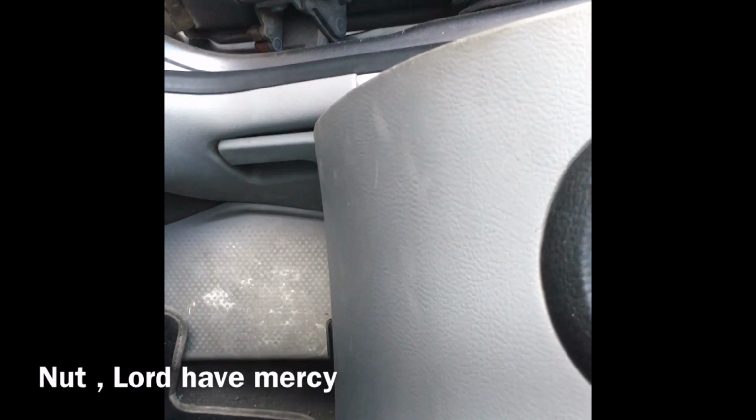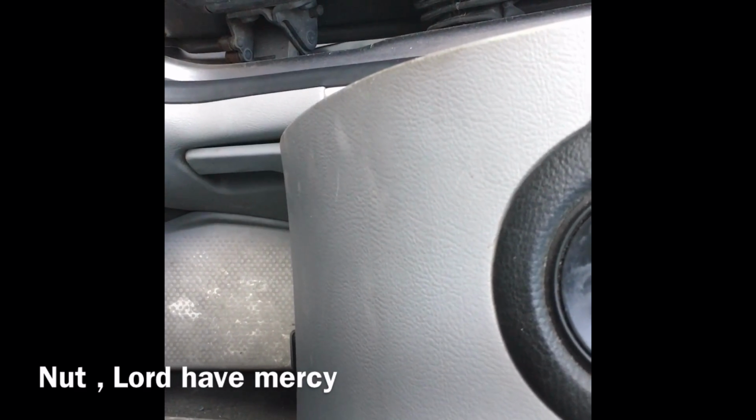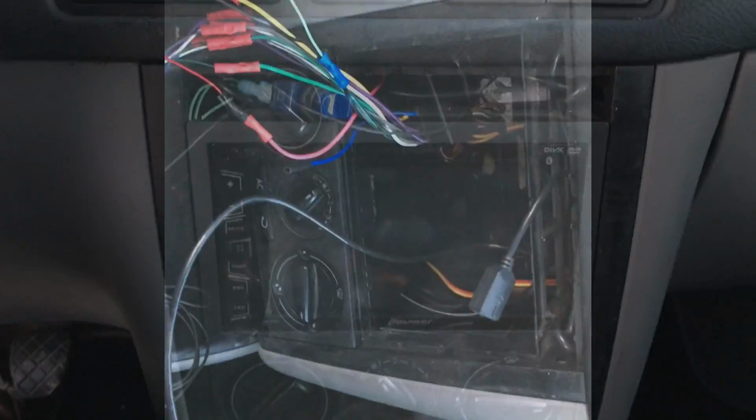You're gonna wanna go ahead and connect that red wire to the far left bolt. It's a far left fuse. It's indicated with a yellow sticker. You take off that bolt and then splice the wire, or you don't even splice it. You basically take off the bolt, put the wire up in there, and then plug the bolt back in. Tighten the bolt, and then you got a constant power source. So that's about it. Sorry I can't show you that part, but hopefully that makes a little more sense, guys. And I'll have my stereo installed and show you here in a minute.